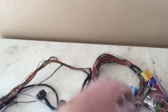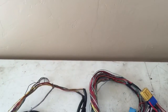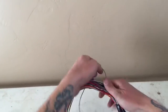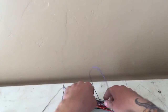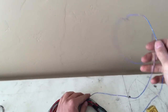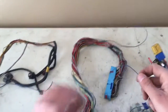This is a good one to see right here — this blue with an orange stripe. I'm just pulling it back to the ECU. You can see it doesn't connect to anything on this side, it's been clipped off, and on this side it will ultimately terminate at the ECU. So this is what we're looking for — we're looking to identify these types of wires that we'll figure out later: what they actually went to, and whether we actually need them. I'm going to set that there for now and continue stripping the harness.